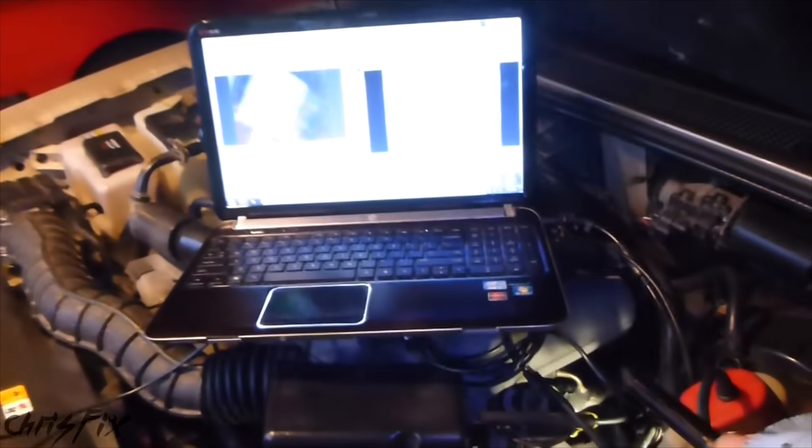Right away, Cylinder 5 looks dirty — does not look like it got cleaned very much. Checking the before and after — again, that black shiny carbon was cleaned up, but the black carbon deposits that were piled up on each other and have been in the engine a bit longer have not been cleaned up at all. The Gumout really didn't do much to remove the larger carbon deposits, which is disappointing because that's the stuff that's really not good for your engine. Last one — Cylinder 6. The before and after doesn't really look like it changed very much. The carbon near the edge of the cylinder is still there. It's difficult to tell if Gumout had any effect, but one thing is clear: the carbon deposits are still there and there hasn't been any significant cleaning. And that was the last cylinder, number 6 — we've finished looking at all the cylinders.